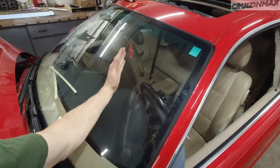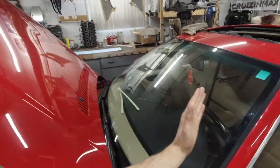So what I had to do, I turned the wipers on, and when they would end up right on top, straight up, I would take the key out. Actually, somewhere about here. And then I would tighten up the nut and try it again, see if they're right about here. That took me about five tries. But when the wipers are up, right about here, that arm on top of the nut is out of the way and you're able to tighten up that nut. So this is what you gotta do. Each time you make an adjustment and need to tighten up that nut, turn the wipers on. Once they're up, turn the key off so they stay up. Work the nut, and just keep trying.